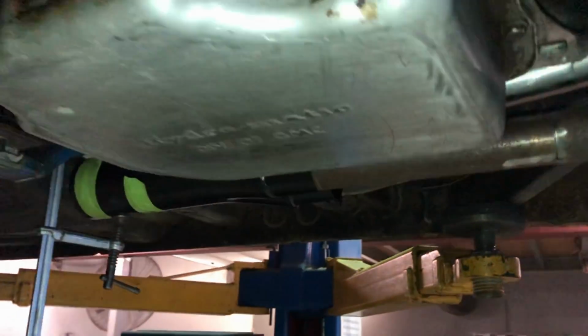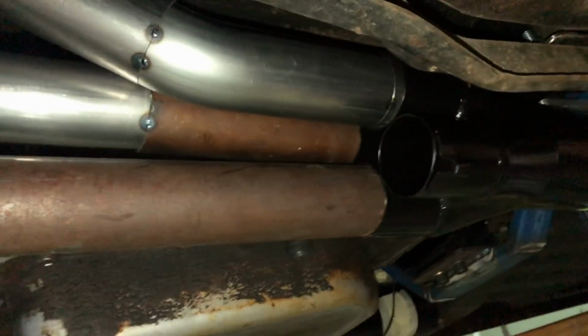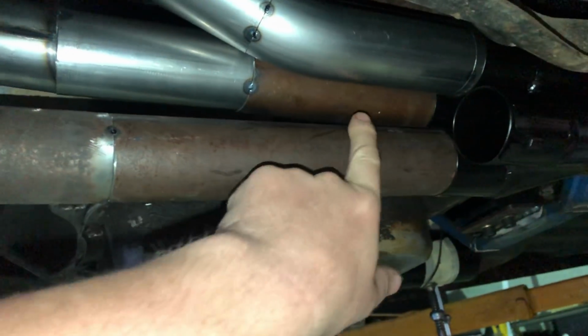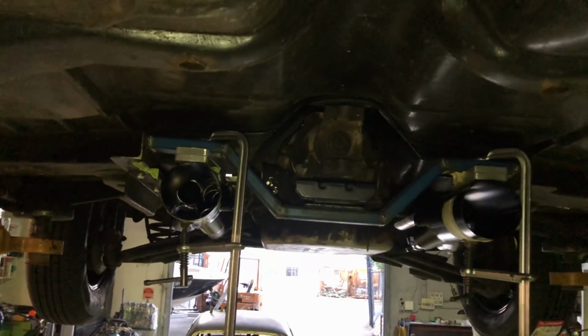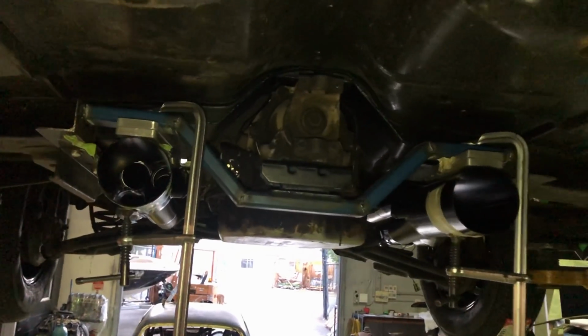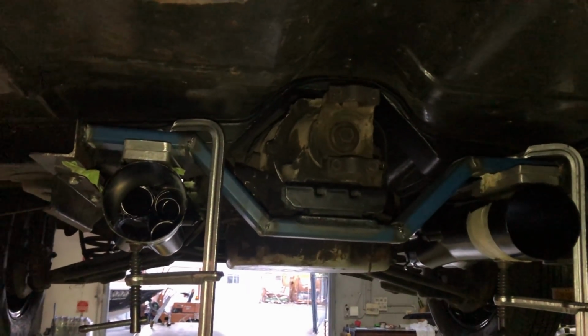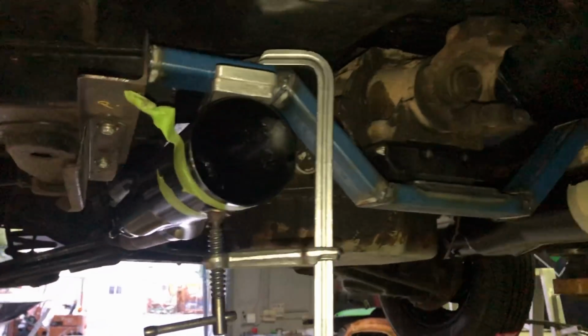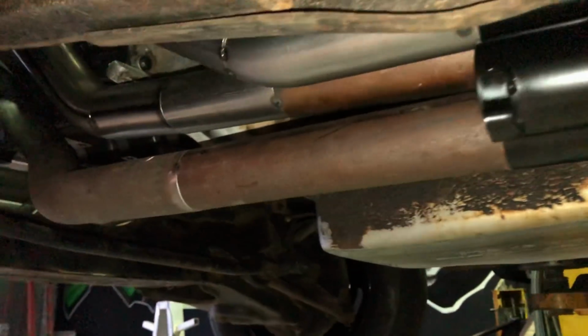So that's that side. So this one here, she's all in, so I had to chop into some old stock that I've got in tubes, so it's a bit of rusty tube. There's a collector. You can see we're up really high. I'm really happy with the height. I've just got it clamped up because we did that cross. Remember the way I did it? The big 2-inch primary into 3.5-inch collectors fit up nice, actually higher than the gearbox, so they'll never have a problem with them dragging out.